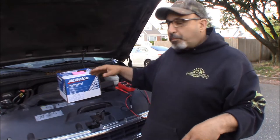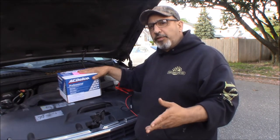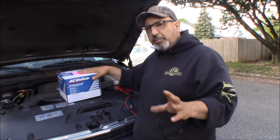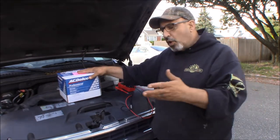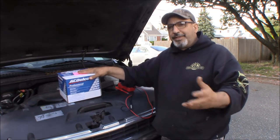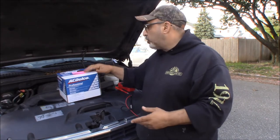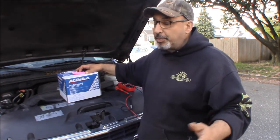So there's a choice of three. You could have a 105 amp in this, you could have a 145 amp, and then you could have some kind of 145 amp special duty alternator. But unless you look at those RPO codes and can decipher them, there's no real easy way to figure them out. On these particular trucks, a K68 would be the 105 amp alternator, the least expensive.